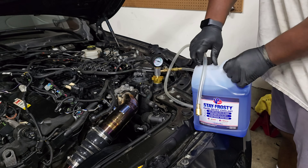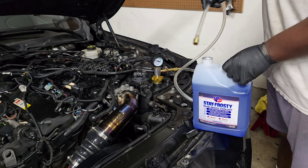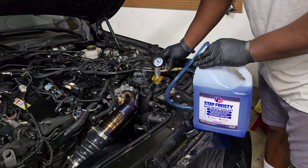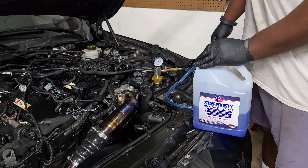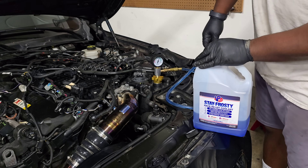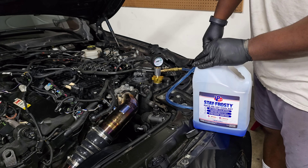We're also going to fill up both cooling systems. I'm going to use my VP Racing coolant in the intercooler circuit, and this time I'll properly vacuum bleed it to fill it up quickly and also do the bleed process in the car to suck it all down. I use regular coolant and distilled water mix in the engine cooling circuit just because I've never had issues with the cooling and I want to make sure I have the freeze protection in winter. Keep in mind I'll need to swap from my VP Racing coolant in the intercooler circuit to BMW coolant when it gets colder — but that's a video for another day. I do have a DIY on how to vacuum fill the system, so check that out if you need some guidance there.